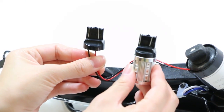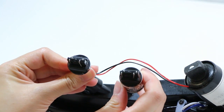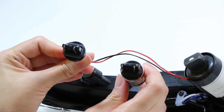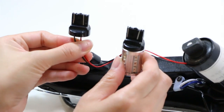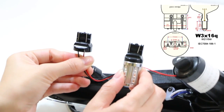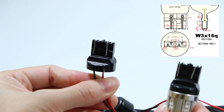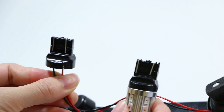Now let's compare our Nissan Altima LED daytime running light 7443 adapter with the conventional 7443 bulb. I'm using a 7443 LED bulb as a reference, along with an insert of a stock 7443 bulb diagram from Don's Bulbs. As you can see, our Altima DRL 7443 adapter pins are aligned in the correct pattern.